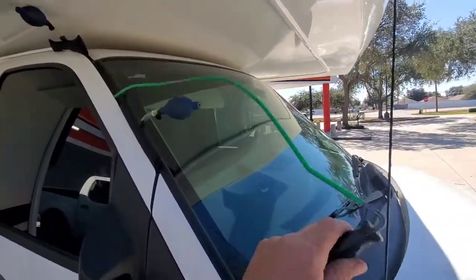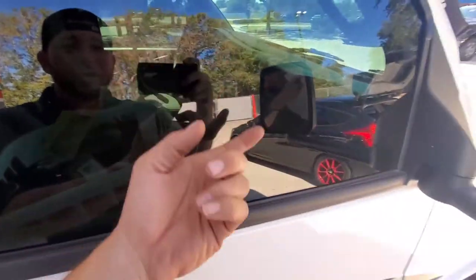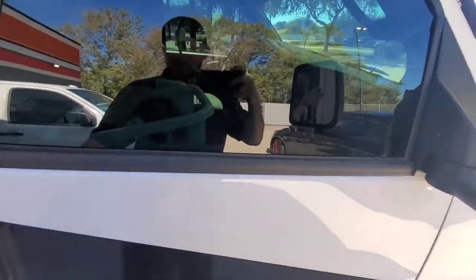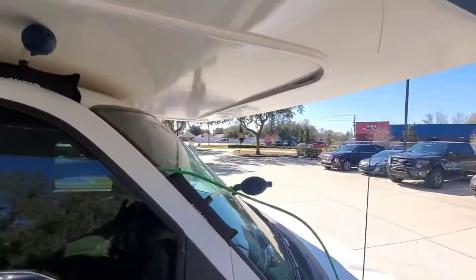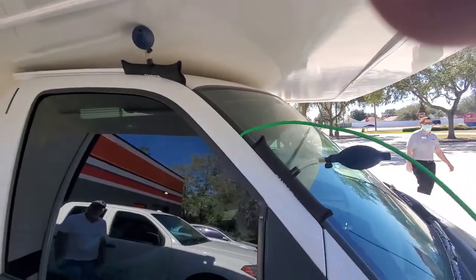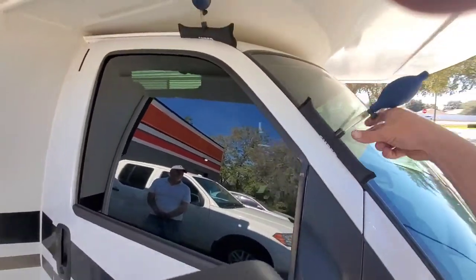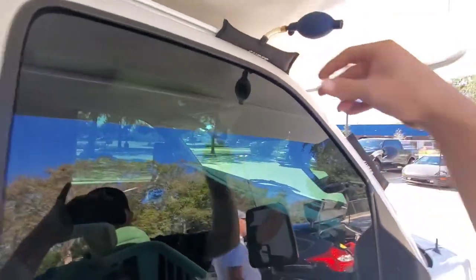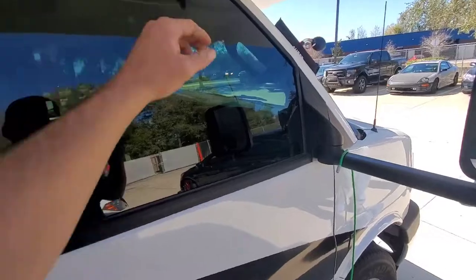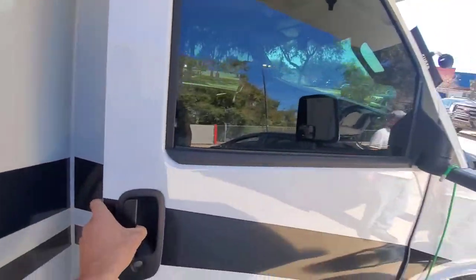I just bend the tool, and what I'm trying to do is come around to the pull-up lock and just keep pulling on it. I think I heard the lock go — I think we got it. So what you want to do when you think you have it is pull all your tools out and let your airbag down so the door will bend back, and then once the door bends back you should be able to open it.